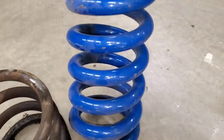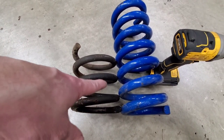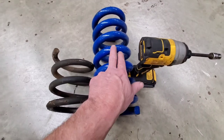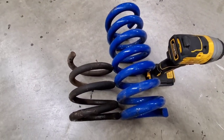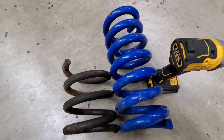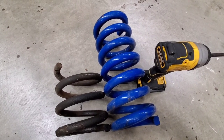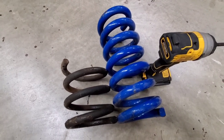Here's the dilemma: I'm guessing they used factory coils that are cut down - we've got one, two, three and a half basically. If I cut this one here I would have three and a half, and most people are telling me I need to start with four to four and a half. There's no way it's gonna go lower with this thick coil than it did with these. But my issue is, if I cut this in half then pretty much I'm screwed because I can't weld it back together. I could easily cut four on this one and four on the other one and be safe, but time to think. I'm trying to kill myself doing this instead of just waiting one more day till there's a parts store open.